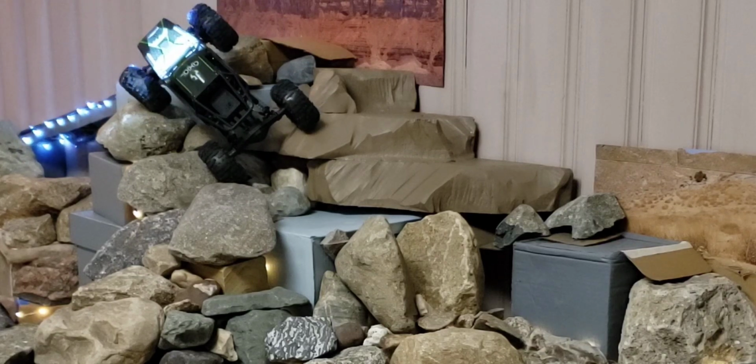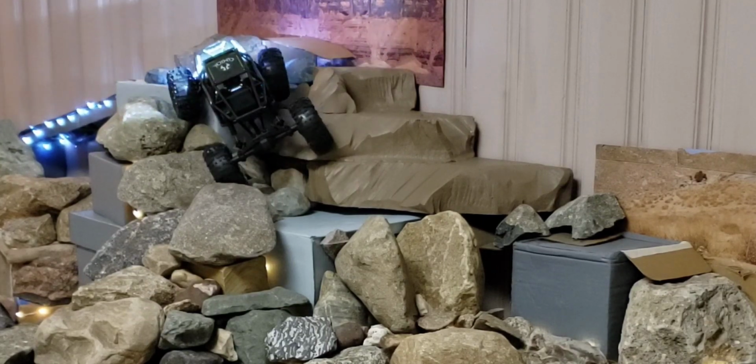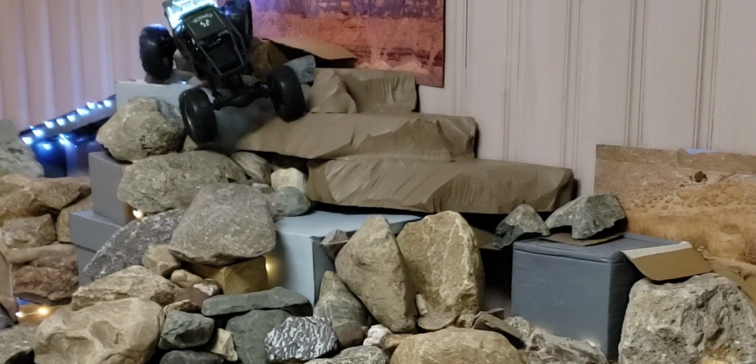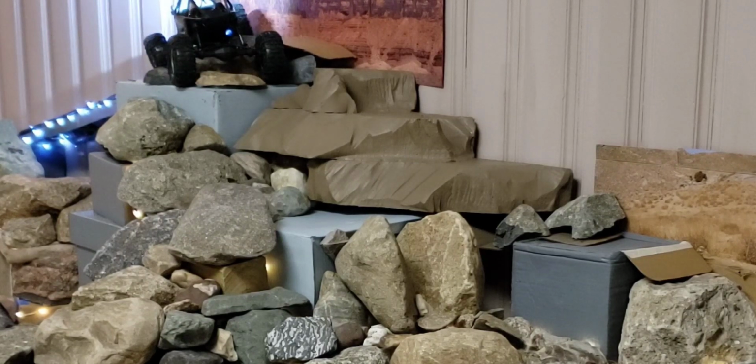Might have my left rear a little bit far over. No matter. I'll take the reverse just to get it up there. But this is a great truck. I don't know that it needs anything else. By keeping the wheels close to stock size, I didn't give away any torque that I did give away when I had 4.19 tires on it. That longer arm from the axle to the ground was noticeable. Also, I had these exact same beadlocks, but all the way around instead of just on the front. And it does give it a forward weight bias, I noticed that. And this thing is a good crawler now.